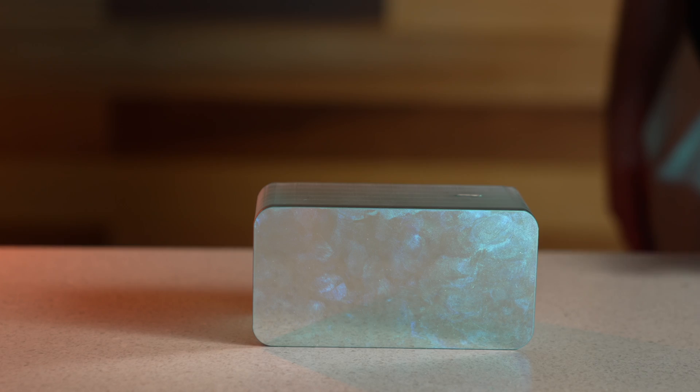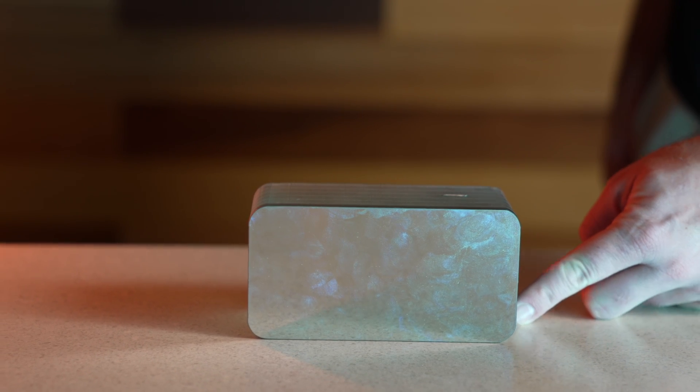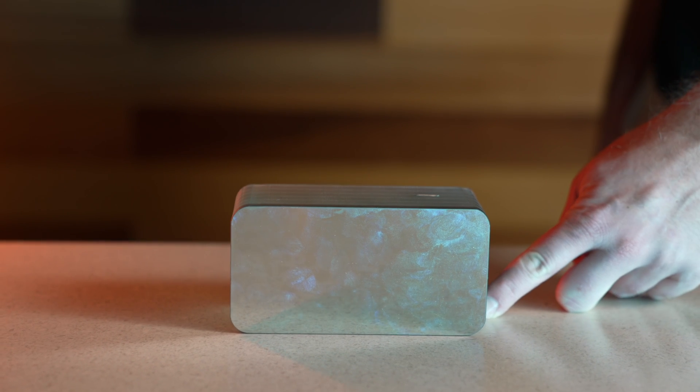Polycarbonate is a more porous material. So any kind of ammonia-based glass cleaner, aerosolized type product — all those are going to be a real enemy to that kind of polycarbonate. That's where you're going to start seeing that glass get cloudy over time, start seeing delamination, having problems with it, and it's just not going to look good in very short order as soon as you try to clean that with any kind of standard glass cleaner.